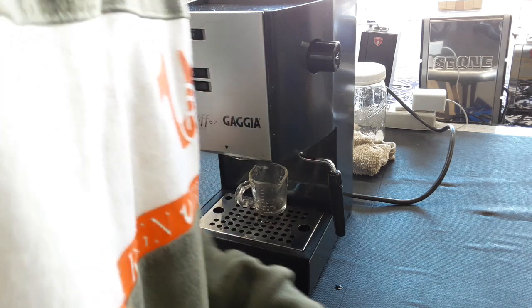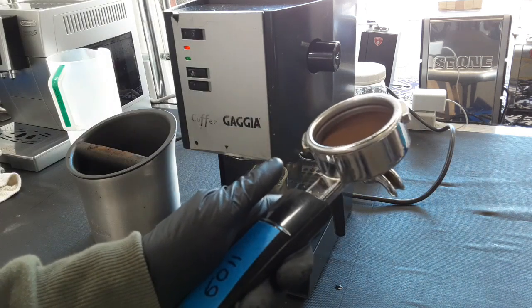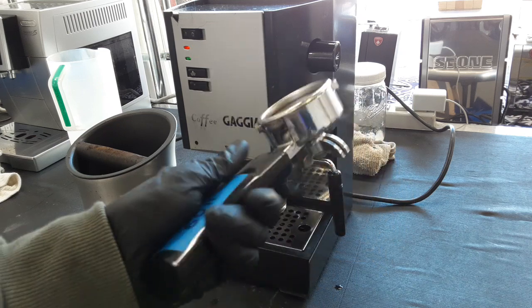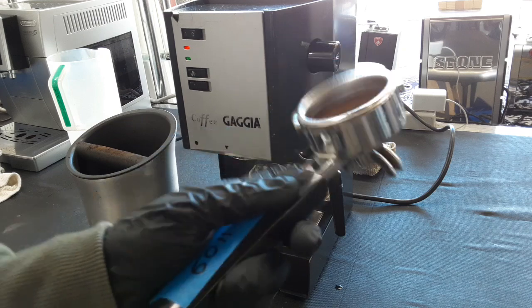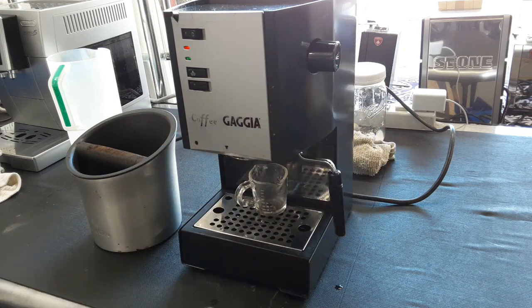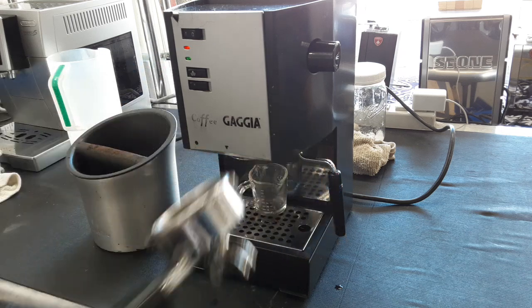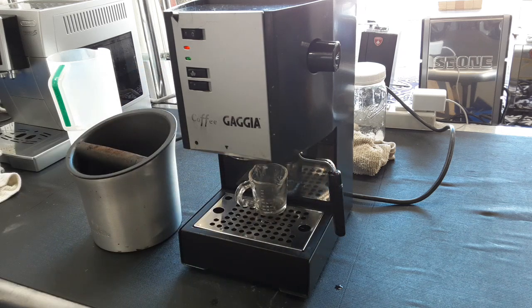And before, when the customer dropped off this portafilter, when you shook it, this knob would just wiggle. Like this head would go up and down, up and down. So we opened it up. You open it through the back with a little pry tool, and you tighten the screw back there. So we did do that also. Do be careful when doing or adjusting the portafilters though, because you could break them, and that means you'll have to buy a new portafilter.